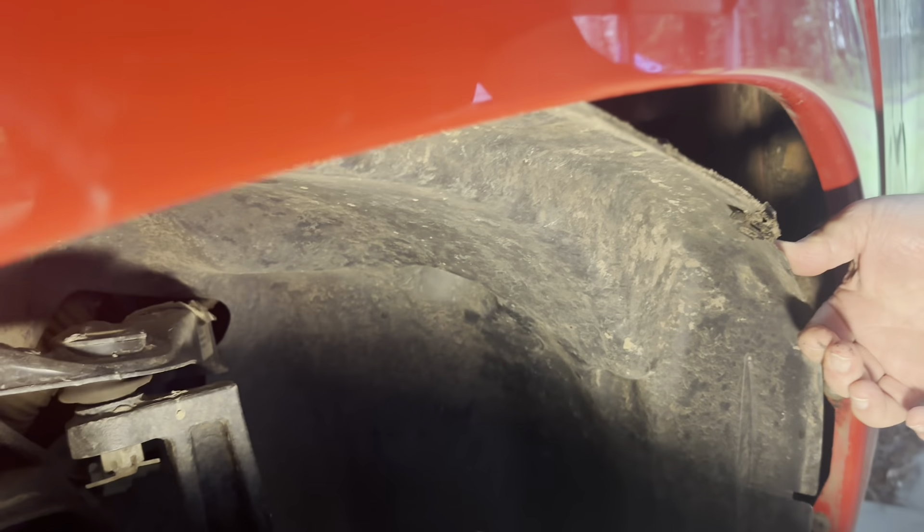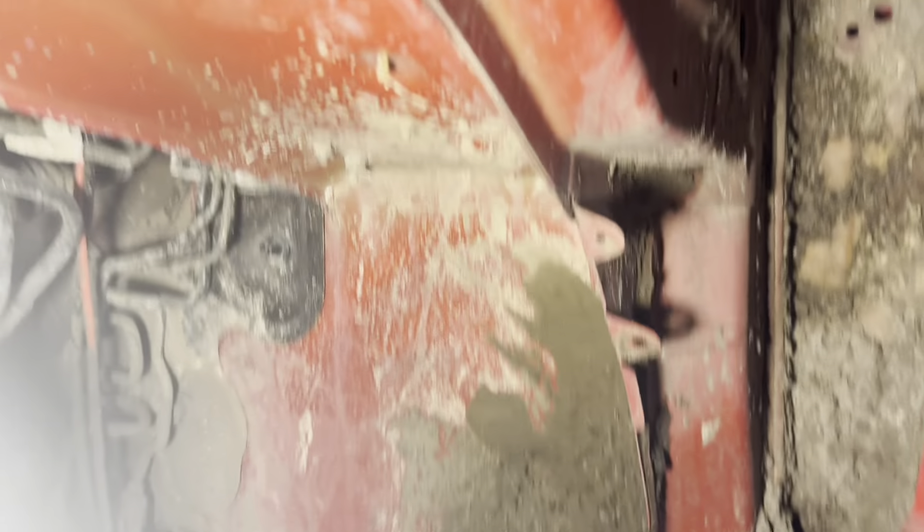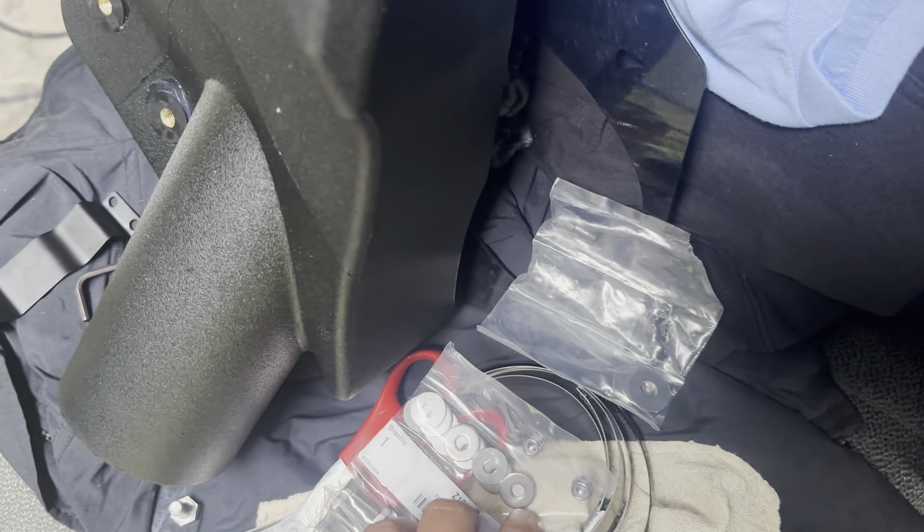We got that done. We're going to try to find something to spray on that exposed metal we cut to make sure it doesn't rust. Then after that we'll get started on taking the fender out. So we got the fender liner out, which is incredibly dirty — I'll probably wash that out before we put the liner back in. Took us a second to figure out which bolts go where. There's no real instructions, but it's pretty straightforward. We figured out these three bolts and these three washers go here. We're going to get some Loctite, get that set up, and then mount it up on the truck.